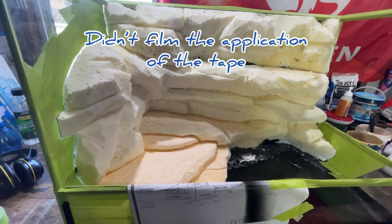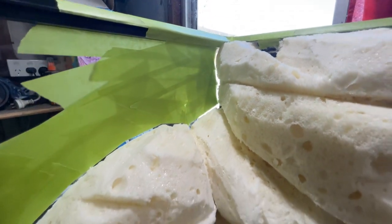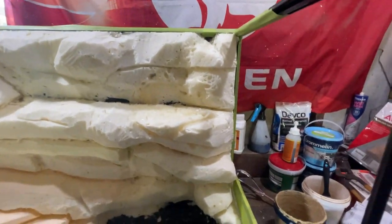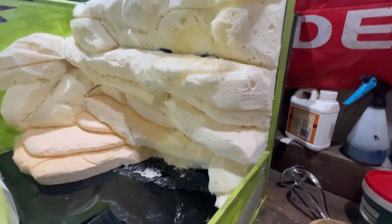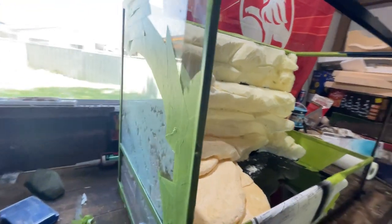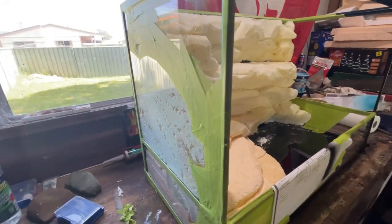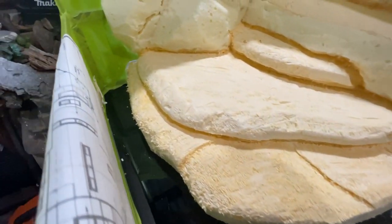All right, here it is all masked up. Now you simply follow your foam around. You can stay a little bit outside it so that the coating will go onto the glass slightly. You can try and cut it back later and make it a bit neater. But make sure that every bit of your black is covered around anywhere that you are putting your coating, otherwise you will not get it off very easily. I've also followed the inside tape on the outside so that when I do the outside coating on both sides, it follows the internal perfectly and will cover all this foam, because you don't want any of that being seen from the outside. So I'll just give you a quick close-up of everything here.